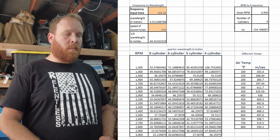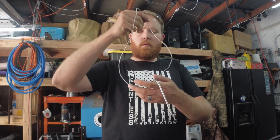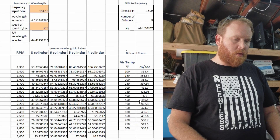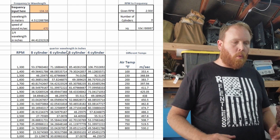Obviously I have to cut the old one off and weld the hole back into the exhaust. So here on the screen is the Excel sheet. We want to mitigate the RPM frequency — we have a five-cylinder motor, which nets about 104.166667 hertz. We did the barbecue thermometer test on the exhaust pipe and got about 530 degrees — readings of 462 and 474 — so I put that at 470 to split the difference. That gives a calculation at 2,500 RPM of a 44.4-inch long tube. Yesterday I cut it at 27 inches, which would have targeted around 4,000 RPM — not where the drone is.